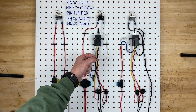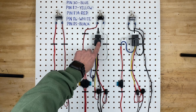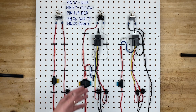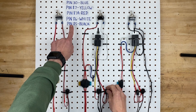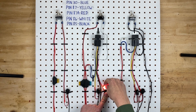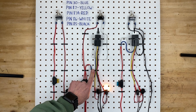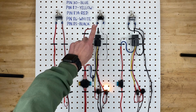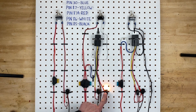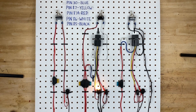As soon as you turn the circuit off, there's a disconnect between the blue and the yellow wire because the relay has opened up that circuit and the yellow wire no longer has power. Now the other wire on this relay is the red wire, which is pin 87A, and if I plug it in you'll see it turns on a second bulb. Power comes in on pin 30 and goes out pin 87A when the relay is turned off. But as soon as we turn the relay on with the switch, this bulb turns off and the other one turns on.